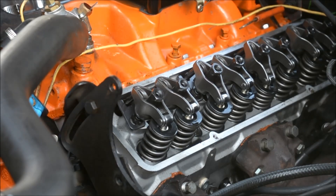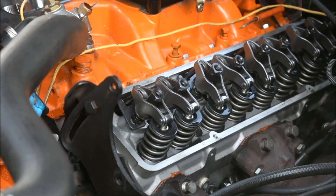Now I could adjust the valves for number one. We're on compression — the distributor would be ready and I'd be ready to fire the car, depending on whether I changed the distributor, took off the intake, or needed to adjust my valves first. On cylinder number one when it's on compression stroke, both valves are closed. Showing you the exhaust valve open and then closing, and then having the intake valve open and then close — that's how I determine TDC.